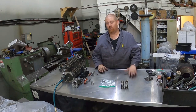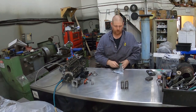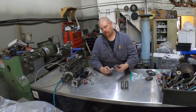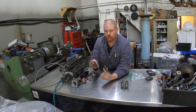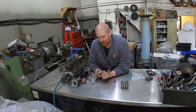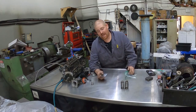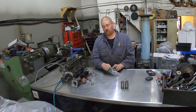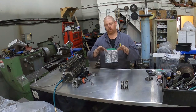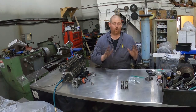The next step is adding more rack travel and removing the fuel plate. You need a kit like this — a different spring versus the stock spring, the bolts that come in the kit, and a washer. I have a video showing how to do this modification. This adds the maximum amount of fuel you can add without changing injectors or delivery valves, so you're getting your max travel kit and removing the fuel plate.